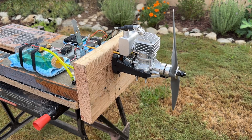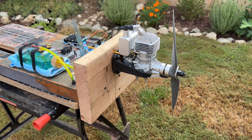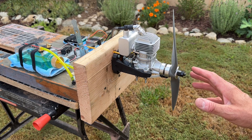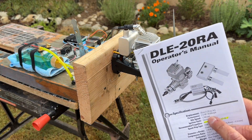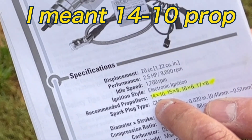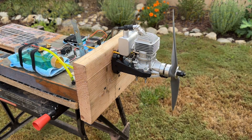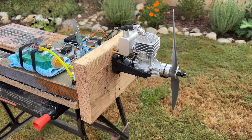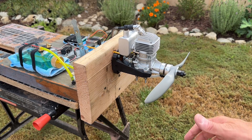That minor adjustment really helped out. I increased about 3,000 RPMs just by turning it about that quarter turn. I'm going to leave it right there for now and let it run a little bit rich. The spec on this according to the manual is 9,000 RPMs. I'm running the 1014 prop so it should be close to that RPM since it's the smaller prop. I'm going to leave it at that setting for now. It seems like it had a pretty good pickup. I'm going to work with it a little bit and check the low speed settings also.